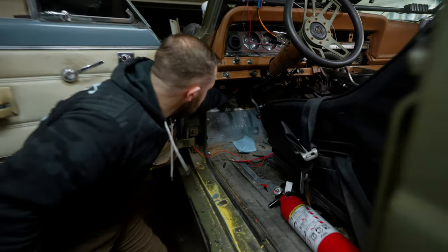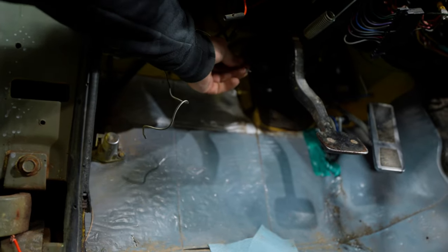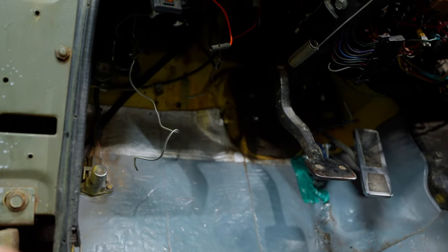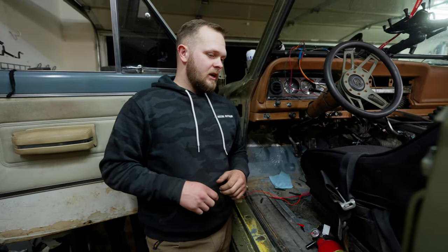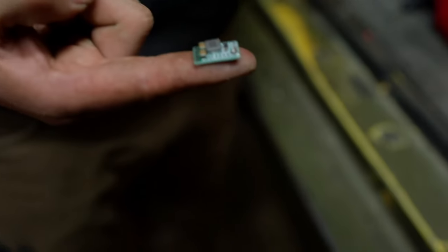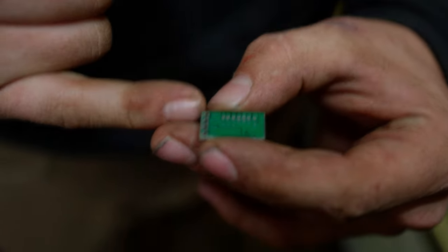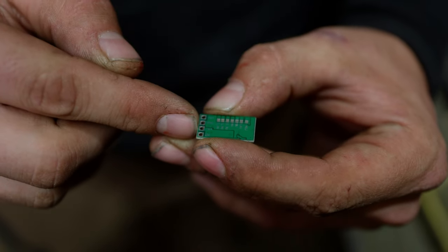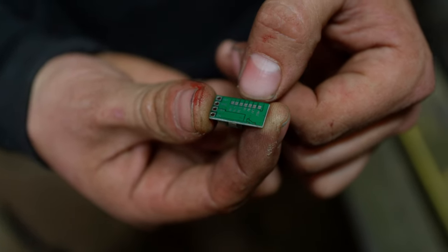In doing so, we have this little module here — I've got two wires coming off of it. I had it all fancy and heat-shrunk, then I forgot what the two wires were because I built this harness back in August. A few days ago I went to put it in and realized I forgot to put in the voltage regulator. The voltage regulator has an adjustment you can rotate, and you've got your voltage hot out, ground in, your 12-volt hot in, and different variables of voltage you can use.